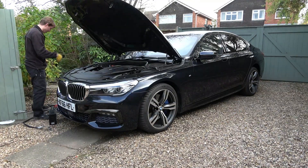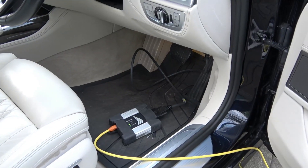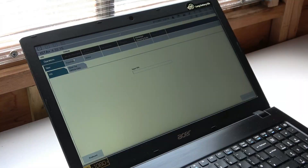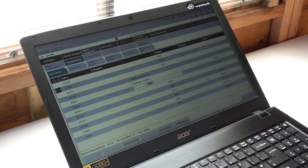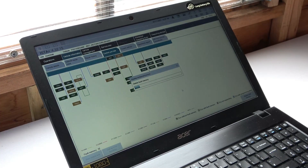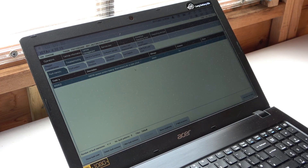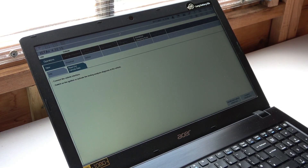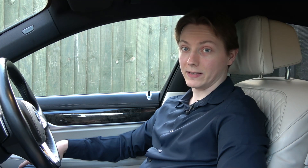Oxygen sensor is installed. Now I'm going to check the fault memory in ISTA. Connect the battery support unit, ICOM, and turn on diagnostic mode. Complete identification. Delete fault memory — and it's gone. But there is another fault: the camera window heating, which probably needs new glue. It will be sorted later. Everything on the list is done and my mechanic is probably right now choking on a bunch of blueberry muffins in the shed. That's all for this episode — see you in the next one.